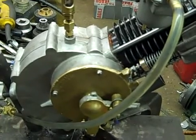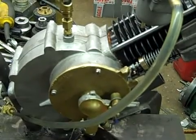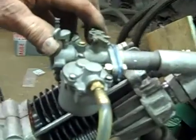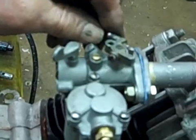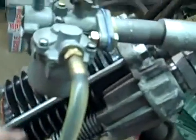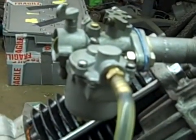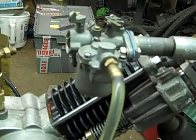So they cannot really be throttled up very easily. With this style carburetor here, you have that luxury to throttle it somewhat, but not a great amount. Otherwise, you get too much speed, you get way out of balance on them. But they're a lot easier to idle, and you can adjust your mix a lot easier on these. Much finer tuning with this, so you get to running a little bit better. That's why this particular carb versus a gas mixer style. And we'll show you that later.